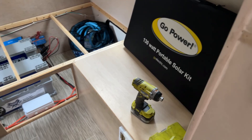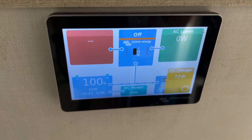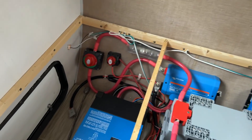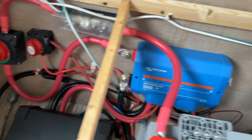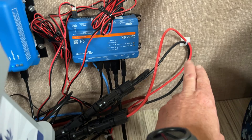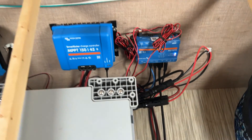Now with the solar, the owner has added some solar to this - it's got almost 500 watts on the roof with those MC4 quick disconnect T fittings. Even though it's a very cloudy day right now, we've got 73 watts coming in solar right now. We've also got a little portable suitcase solar system here. There's an Anderson quick connect right here that'll be used to plug in an extension cable. I've got that going to the standard outdoor MC4 quick connects like you'd see on the roof of a solar installation. Those wires run along the wall back there and then tee in to the ones that come down from the roof. So these wires here come up from the roof, go into here, and we've got the ones that come from the Anderson quick connect right here next to it, which then basically feed right into the MPPT controller.